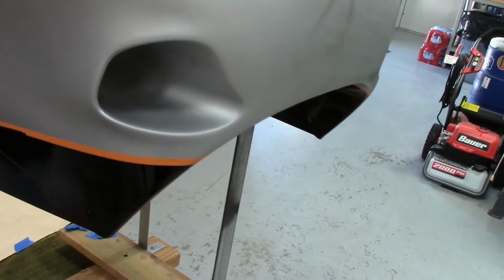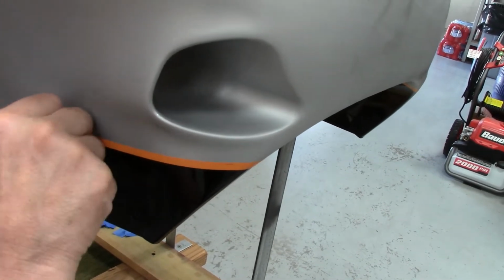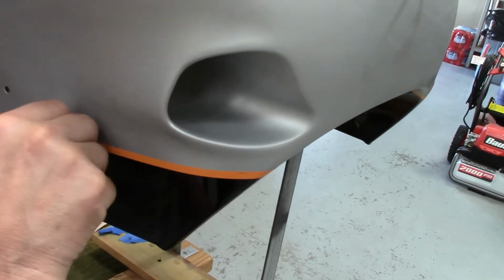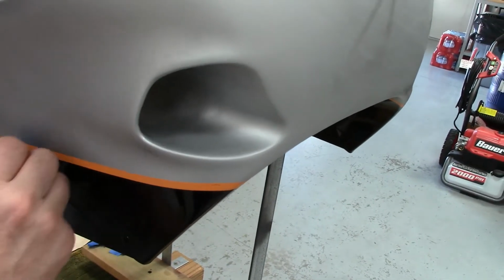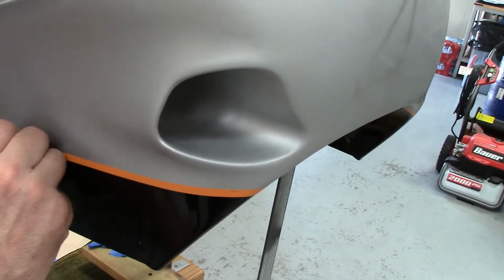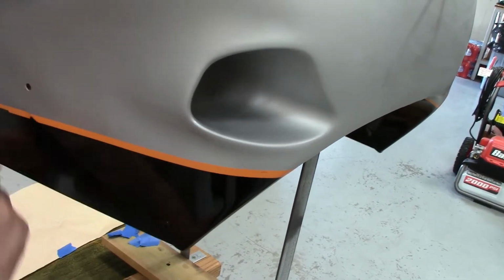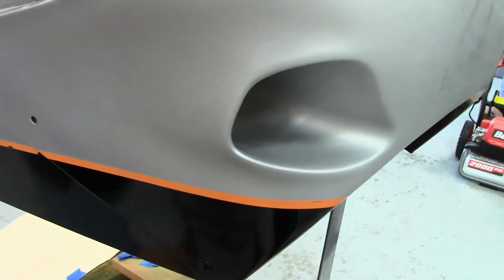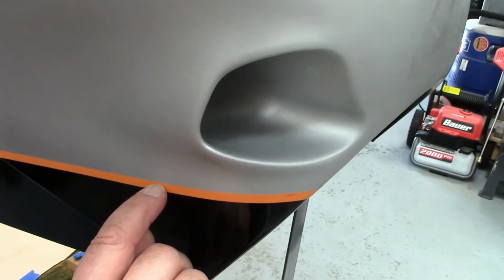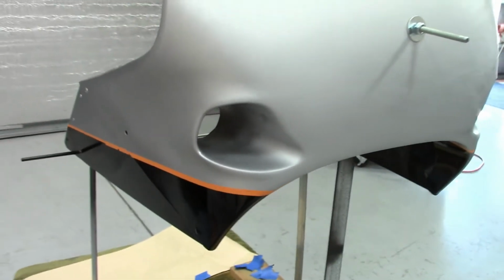And see, it's prepped and sanded here. It's just on the vinyl fine line tape. And slowly but surely, on the fairing panel it's nice and secure, and on the vinyl fine line striping tape, see, it's coming off. So I got to get all that off real carefully, and then I got another surface here that I can come up about 3/4 way and take off the black. So let me do that. I'll be back. Just wanted to show you that chip.